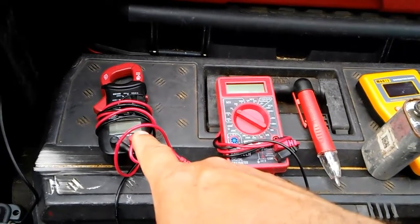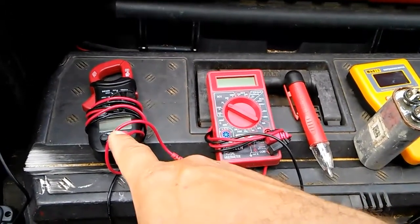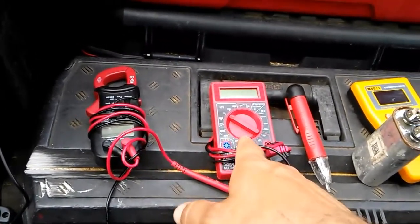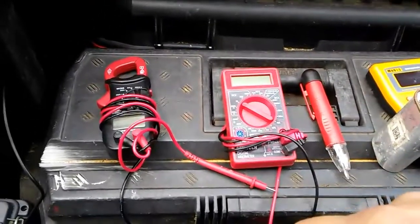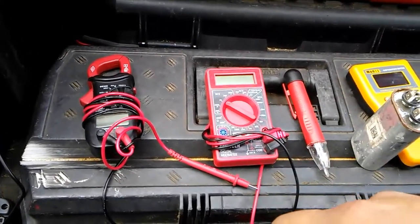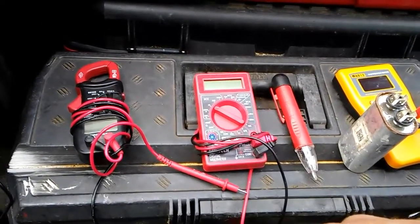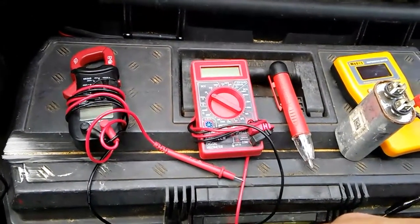But the voltage reading, especially with automotive 12 volts, it's not going to tell you if it's 12.1 volts or 12.9 volts — it's just going to say 12 volts. So that's why I got this meter. It'll give me a finer scope of what I'm looking for, because with automotive there's a big difference if your battery's holding a charge at 12.1 volts versus 12.8 volts.